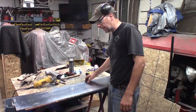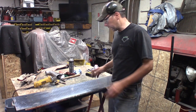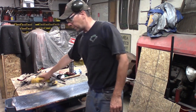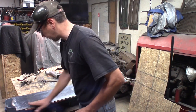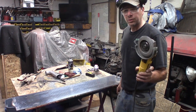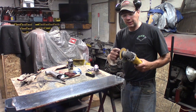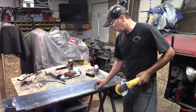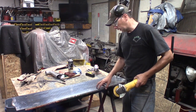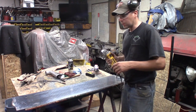It got super hot out today — like 90 and humid. I've got my aluminum diamond plate here and before I glue it down I'm going to wipe it all off with brake cleaner to get any oil off it. Then I'm gonna take the grinder with a flap disc, stand it up on edge and use the aggressive part to rough up the inside edge all the way around, to give the panel bond adhesive something good to bite into.